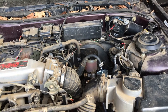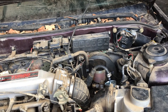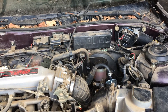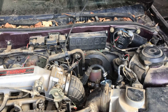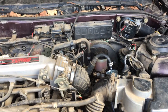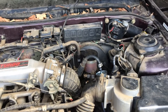Welcome to Ben's channel. We are working on the 1989 Ford Probe. When Ben got this car he was told by the previous owners that it had a fuel pump issue, which he tested and confirmed, so he replaced the fuel pump. That didn't stop the problem — it still doesn't start. We have fuel pressure now, but it's not firing. The next step in troubleshooting is to test the spark.